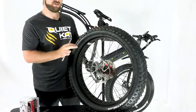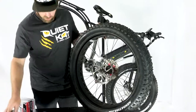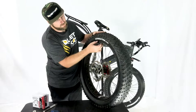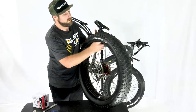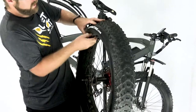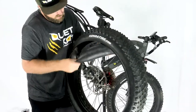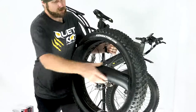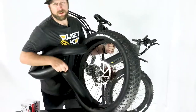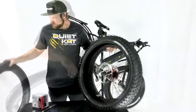It's much easier to just peel one side and leave the other side on the rim. Locate the valve, push the valve up into the wheel, then reaching inside the tire grab the inner tube from the valve and slowly start pulling the inner tube out of the tire. You'll notice the inner tube may still be rather inflated — if you have a hole in yours it'll be completely flat. Discard the old tube.